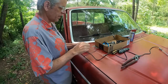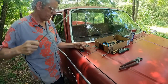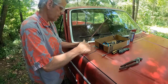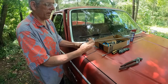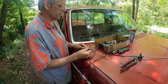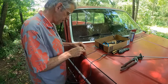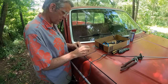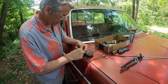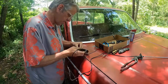This goes on the top, this goes through. So you get this ready — that's ready to go in. We're going to tape this to this and then feed it through. We might put some WD-40 on it. There's a little rubber grommet down in the cowl and that has a tendency to get hung up. If you can't get this to work, you have to take the cowl off this whole section by the windshield, and it's just not very fun. So we're going to try to tape this up.